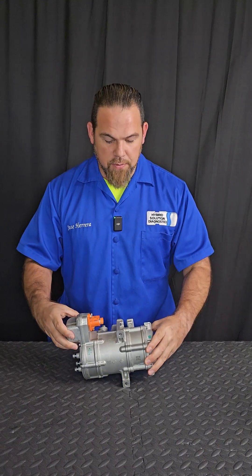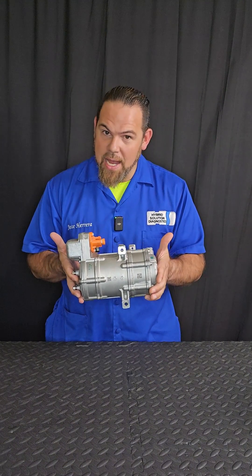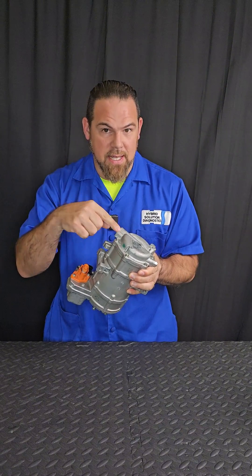Now, the only way to find out, we're going to have to open the air conditioning compressor of this 2022 Nissan Note E-Power, although I think all the E-Power cars use the same compressor. The main differences between a regular compressor and a hybrid electric car compressor is that this compressor is just a high-voltage electric motor with a scroll-type piston inside.